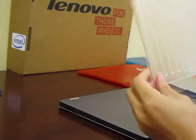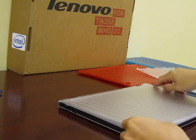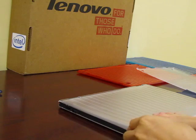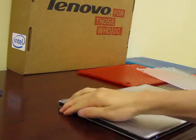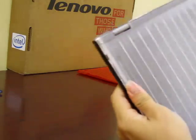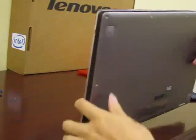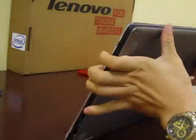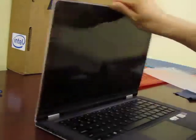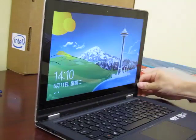For the top cover, you will need to align the tabs in the back near the hinge and push down until you hear the clicks. You have six tabs on the top case, and you will need to make sure that the tabs have clicked into place. When you open your laptop you will see the tabs. If the tabs are not grabbing your laptop, push them into place until you hear a click.